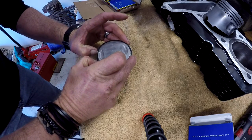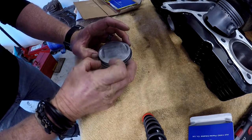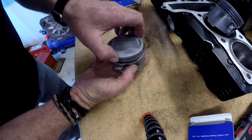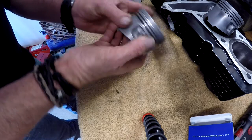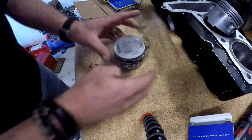But, you know, the Yamaha manual says that you just put it so it's at the quarters, right? Yeah, on the quarters. And that's all right. We just make sure that they're not lined up. That's the key thing. That's one down, four to go.